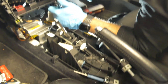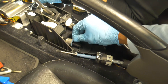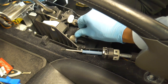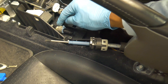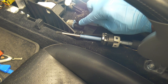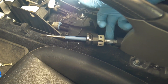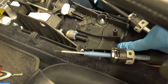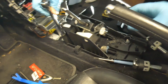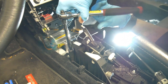We were able to disconnect the cables after watching a couple of videos. Basically once the center console is fully exposed, you push these cables forward and twist them — they'll stay in a locked position with the spring depressed. Then slightly pull them out of their holding place inside the spring-loaded mechanism. With equal pressure, one finger on each side, pull them out of their grooves. Do this for both sides, then remove the four 10-millimeter bolts — which Chris is now removing — and the shifter should be released from the console.